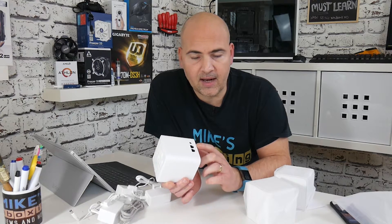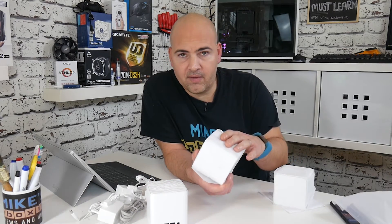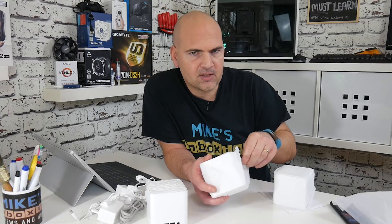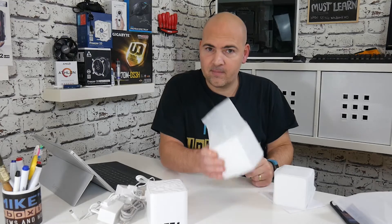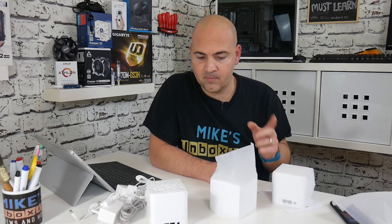On the primary box the ports are configured as WAN and LAN, while on the other two boxes they'll both be configured as LAN. From my reckoning this can be used to do Ethernet backhaul. In our layout, the modem and primary router will be in the front room, the secondary unit in the bedroom above, and the third unit in the back of the house. With all units connected via LAN cables, it should distribute the entire network for both wired devices and Wi-Fi, all on the same Wi-Fi address range.